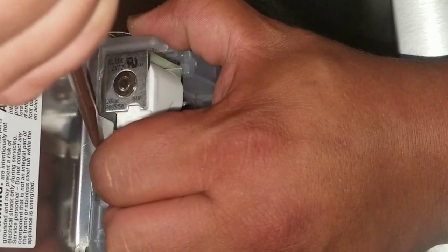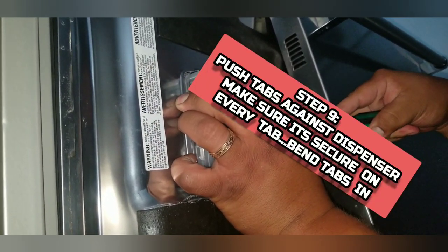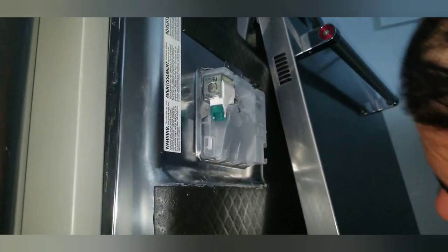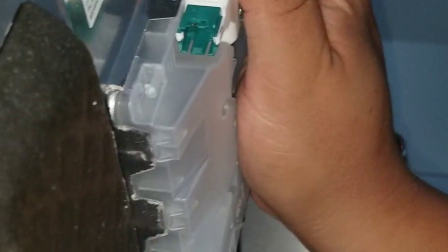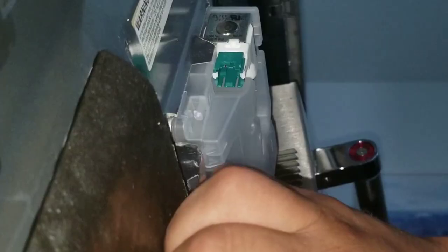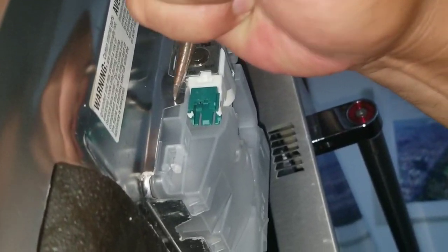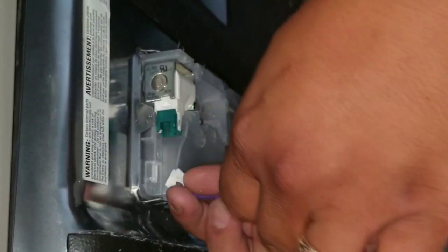Then you can pull the soap dispenser from the back or from the front. Make sure all the clips are clipped in properly and bend them in slightly so they don't go anywhere. Bend them in now to hold it in place, making sure it's sealed nice. One test you can do is open the door all the way and pour a cup of water around the soap dish, then shut the door and see if any water leaked out. You want to make sure there are no leaks because you won't see them once you put the door back on, and you don't need any leaking on those wires or on the floor. Push in those tabs and make sure they're all clicked — this one had about eight tabs.